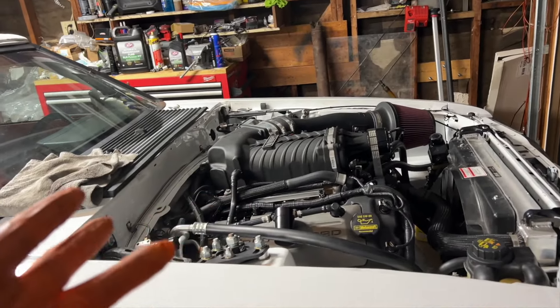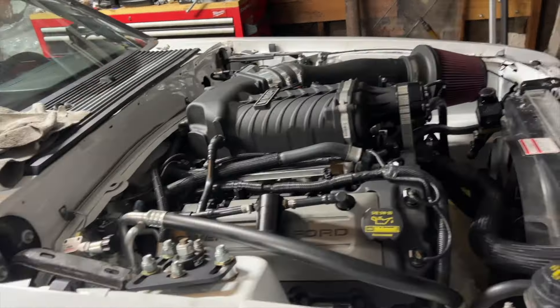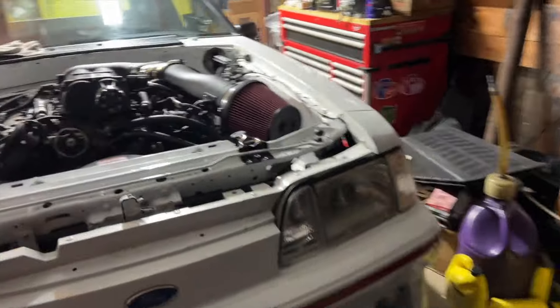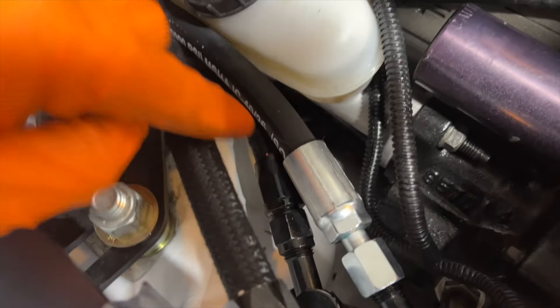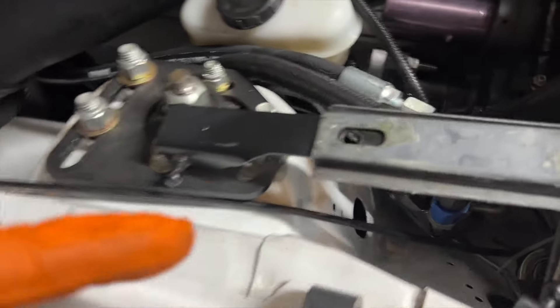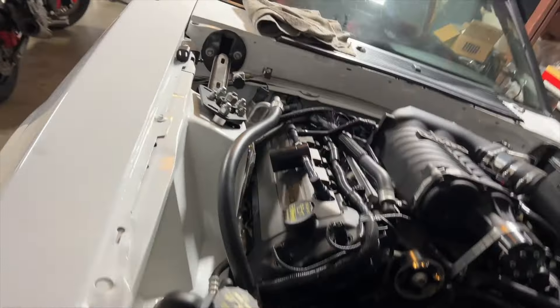Look at Arlen — did this by accident, so precise and perfect, fits the motor mount bolt perfectly. I'm going to put this on and knock this out. There are like two or three straps that came on the coyotes. Also forgot to mention — did the spark plugs: got the NGKs, gapped perfectly for the supercharger setup, put them in. Now we got the juicy ground strap on the motor and the ground for the actual engine harness. The power steering line that was leaking was replaced with one rated to 5,000 psi — that will never be exceeded. No more leaking, no more spewing, no more smoke. Now focusing on the air conditioning.